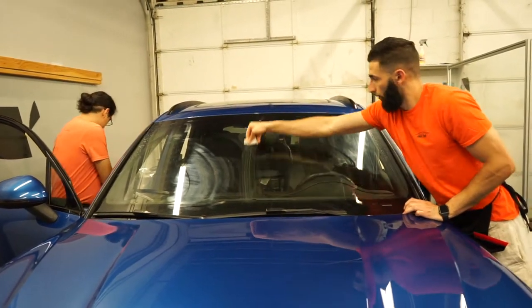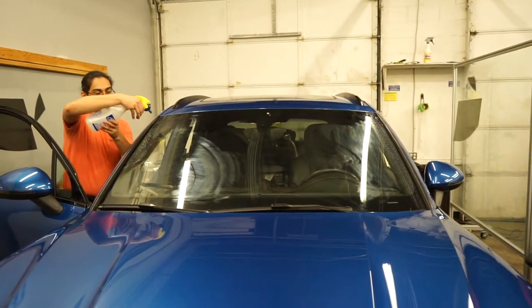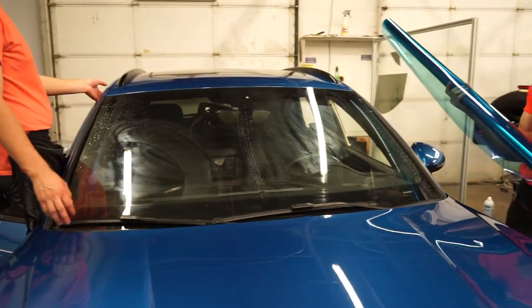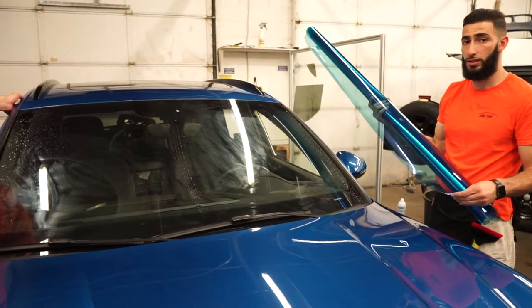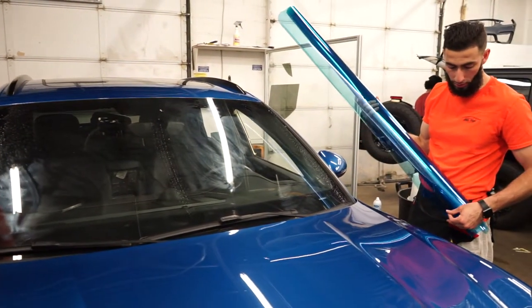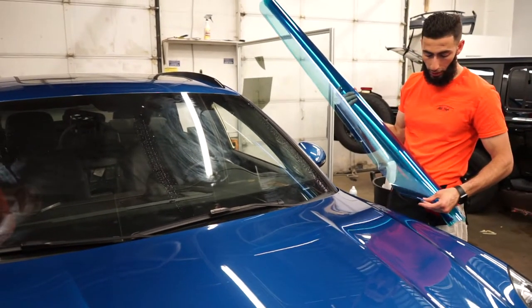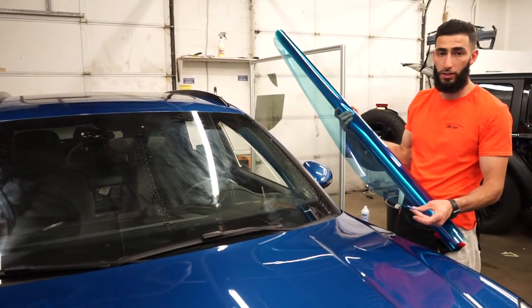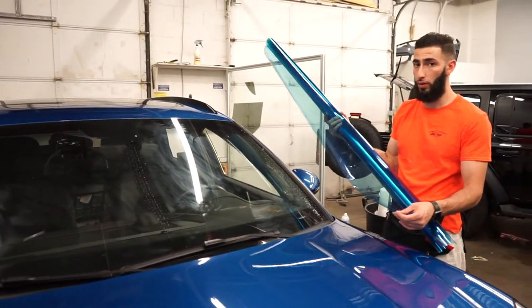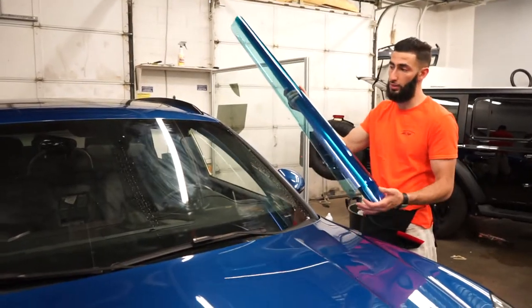Now we're going to make our three little lines. Before you lay it, you want to make sure that you're shrinking with the liner side up and not the film side up. So what I'm doing is just rubbing the two pieces of film against each other. If the film slides, that's going to be the liner side. And if it sticks together while you're rubbing it, that's going to be the film side — so you want to make sure the film side is down.